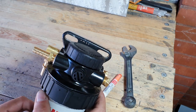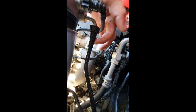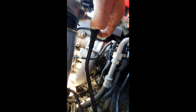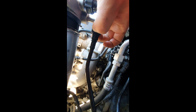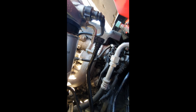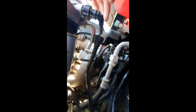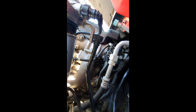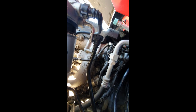Before my fuel filter goes back in, I'm going to disconnect the actual fuel line supply hose. It has a button on either side — you just press down on those and pull back. There we go, line disconnected. That line is going to run onto the intake of our fuel filter, and then we'll run the outtake hose back to this connection down here. That's where you need those quick-connect fittings — it makes the job a lot simpler and you don't have to cut any nylon hosing.